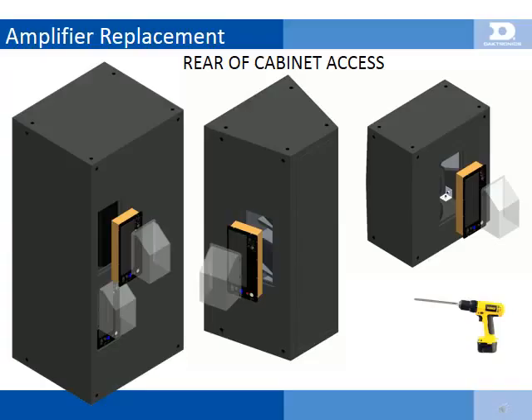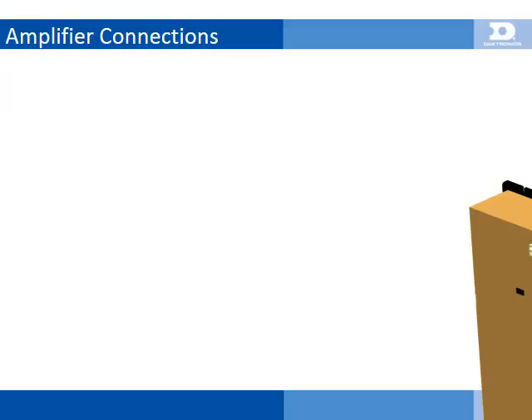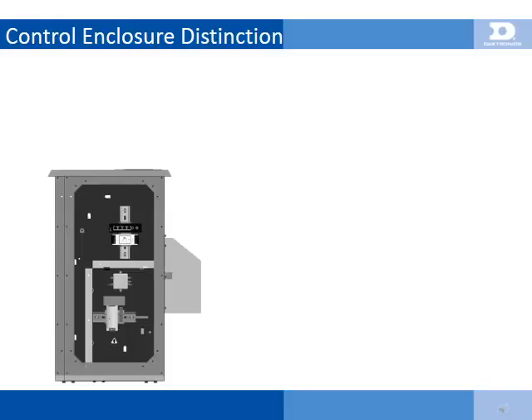Amplifier service is achieved through the rear access doors of the 1500HD cabinet. Amplifiers are mounted with No. 2 Phillips screws and are quickly removed with a cordless drill driver. All amplifier jacks are keyed, so there is only one correct connection per cable. Each speaker cabinet — high, mid, and low — is considered a self-powered speaker, meaning the speaker has a built-in amplifier module. In the 1500HD and 2000HD, most amplifiers are two-channel modules. The amplifier's power is provided to the speakers via connection with a white 6-pin Molex connector.